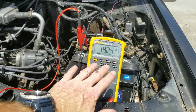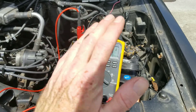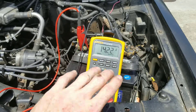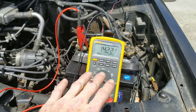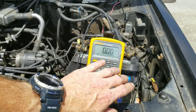So if your voltage is good up to this point, then you need to check other methods — check out some of my other videos. If not, if you didn't get a good voltage reading, then the next step you're going to take is a voltage drop test, and you want to make sure you have a good connection.